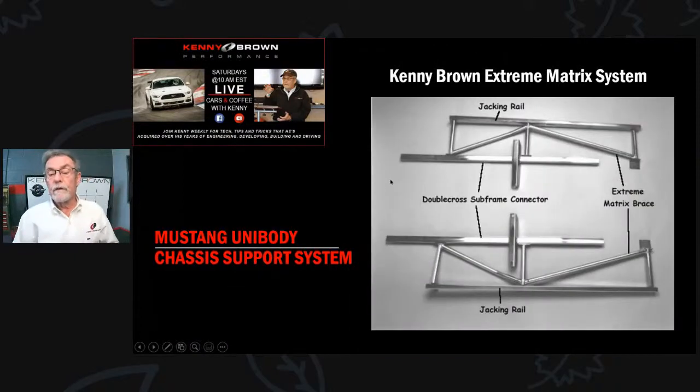And here's a little different view of it. Now, this is actually for, I think, the 96, 98 Cobra, somewhere in there. We actually have to shorten them up a little bit due to the transmission mount. But even so, the subframe would be right here, and it still connects 4 triangulations, connects front and back, cross in the middle so it doesn't flex. I mean, this adds an enormous amount of rigidity to the center of the car.